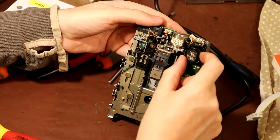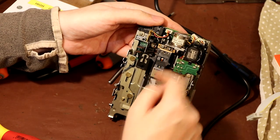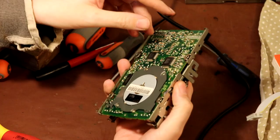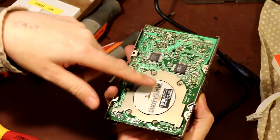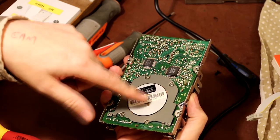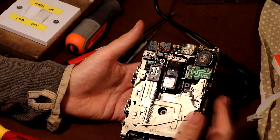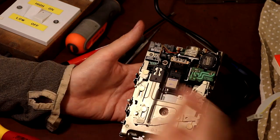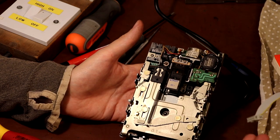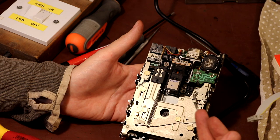At the top of this disc drive we've got a couple of motors: this motor here I'm guessing is part of the eject mechanism, and then another motor which moves the disc drive heads backwards and forwards. I tried disconnecting that one and it didn't seem to reduce the current. The only other motor is this one on the back — I think it's a DC brushless motor — which spins up the disc drive itself. This motor seems to be moving, but for some reason when I actually put a disc in you could see it started drawing what I'm going to call excessive current. I don't know what current it should draw, and I might be getting a false positive from this lamp limiter. My gut feeling is if I turn the lamp limiter off something probably will go bang.